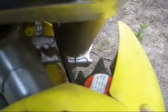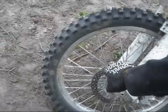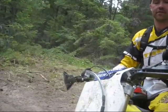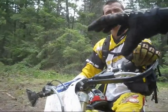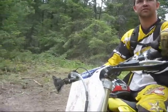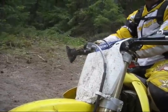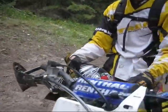That much tighter — sorry, a little tiny bit. This one's a little more gap. I'm going to fix that. Maybe my wobble is back. No, no, no. That's a bend — that's just a high spot. You probably bent your rotor. Hey, when you ride down the road and you just put finger pressure on your front brake, does it pulse? Pulse, pulse, pulse. Nope. It's pretty steady. Okay. Well, you can't always tell. But I don't really hold it down when I'm ripping — I just feather it, right? I don't really squeeze it that hard.